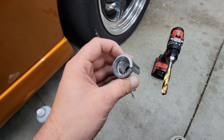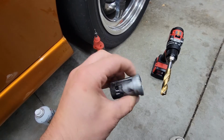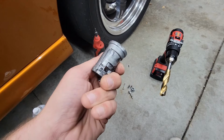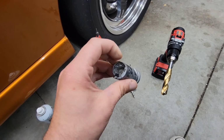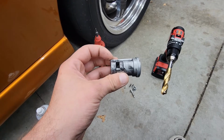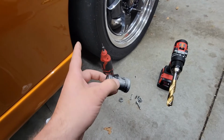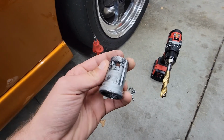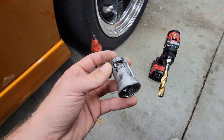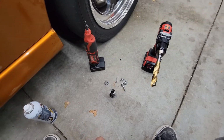If you haven't already done the updated lock cylinder itself, it's pretty cake to do as long as that pin isn't jammed. Worst comes to worst, as long as you've got a current registration card and a form of ID that you can take into a locksmith, and as long as they have access to a Mercedes style shank, the actual blade itself, which is what these cars call for, which is something I learned today from a local locksmith, the one locksmith in a town of 150,000 people that can actually cut a key for these damn cars, then you should be able to get